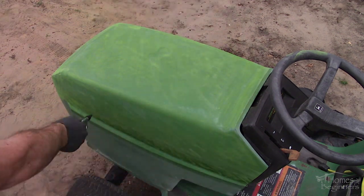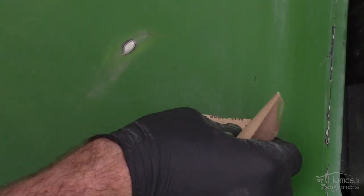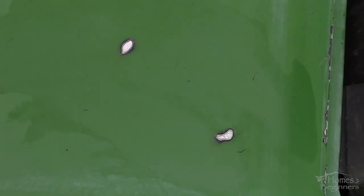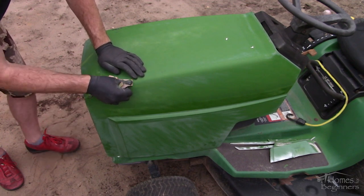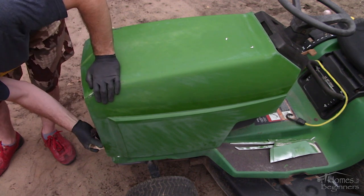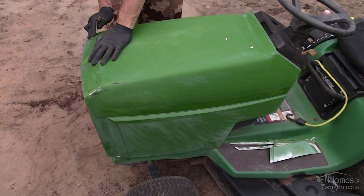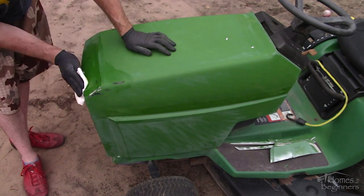The hood is only a small surface so there's no need for any power tools or air tools. Use compressed air to remove any sanding material from the surface. As you can see we do have a couple of damaged spots — just slight surface damage but it will be visible in the paint if not repaired. Use 220 grit by hand to remove any loose material out of these areas, then clean the area using a wax and grease remover. A wax and grease remover is used to remove any contaminants which may cause adhesion issues for the filler. There was light surface damage on other parts of the hood so these were also touched up using 220 grit sandpaper. These light surface imperfections can include anything from chipping, peeling paint, scratches, or scrapes. There's no need to cover the rest of the hood with 220 grit sanding marks as it's a good base — using a coarser grit paper would require sanding with a finer grit after, and if not done correctly can be visible in the final paint finish.